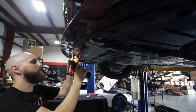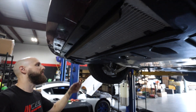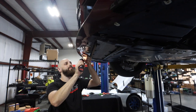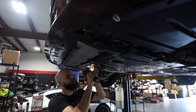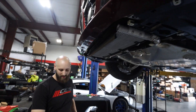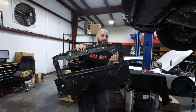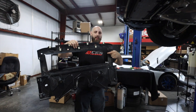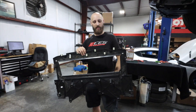We're going to take out the bolts in front of the bumper — you just have to take off this little piece first. You can see it's broken on both sides, only being held in by that little rubber piece. That rubber piece is there for flexibility, so it can butt up properly against the cooler without actually puncturing or damaging it, giving you a nice flexible piece that's not rubbing or anything like that.